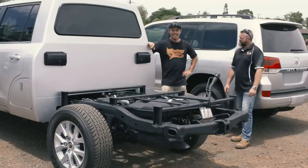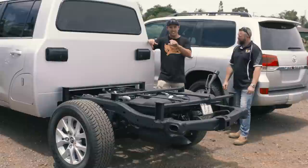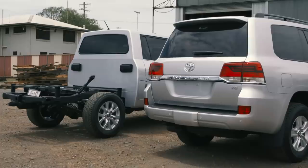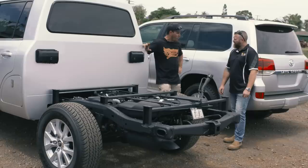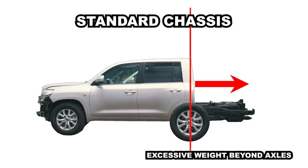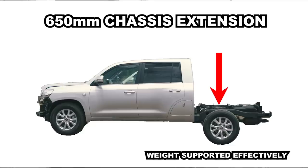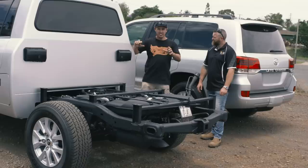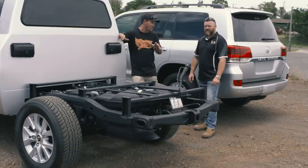I want to show exactly why I've decided to extend the chassis on my 200 series. Mine has a 650mm extension — compared to a stock standard one you can see the rear tyre position moves out quite a long way. A 650mm chassis extension is the most popular choice when someone chops a 200. If you leave the wheel in its original space and put even a shorter tray on it, all your weight carrying is back past the axle. When you move it 650mm it spreads your load a lot better. I want a full-size canopy and tray on the back plus I'm towing a big boat, so with that 650mm extension a lot of that weight is going to be between the axles — and that's exactly where you want it.